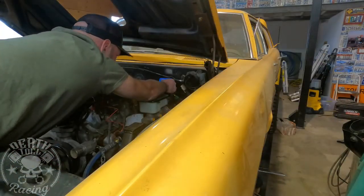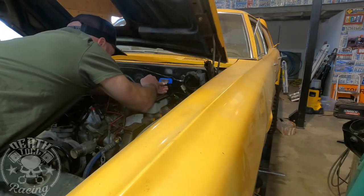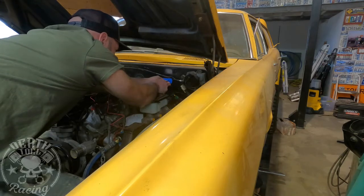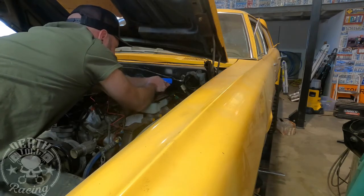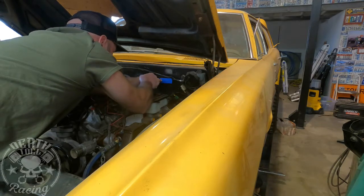Now I'm just laying out for the bracket. I just used a piece of tape so we could see the marks a little better, and using a spring punch, we'll punch the centers. And then we're actually going to use nut inserts. So I'm going to drill mine. I'm going to do 1/4-inch nut inserts, and we'll use a flange head.